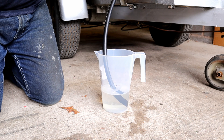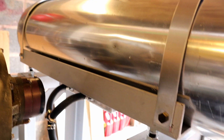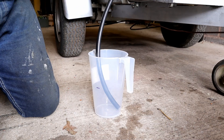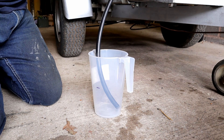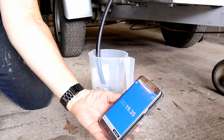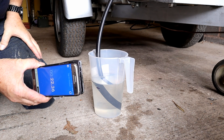Okay, that didn't go very well — it hasn't dispensed a litre. Well, that sort of makes sense. I guess the fuel tank has around about one litre in it before the fuel actually reaches the exit pipe from the tank, so I'm going to put a bit more in. Here we go again. One litre in 22 seconds, so that's about two litres a minute — that's pretty good.